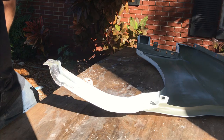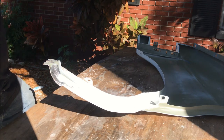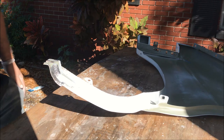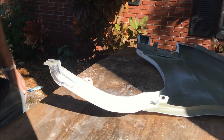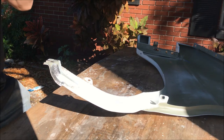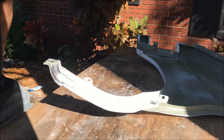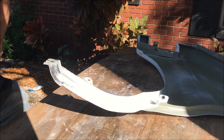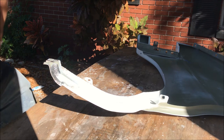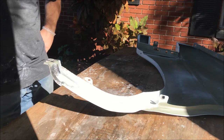I know the sun is on it — I'm doing this just for the video. I'm going to spray the rust reformer on the underside, the backside that isn't visible, just to protect that metal. There was some metal I had to grind off that was a little rusty, and I'm happy with it. Once the rust reformer sets and dries, I'll flip it over, prep the finished surface again, and start priming and finishing.